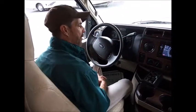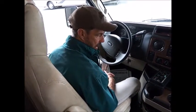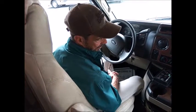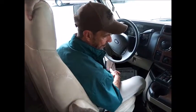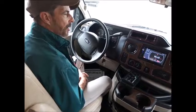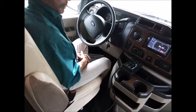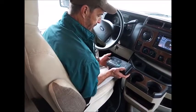When I turn the key on, it won't start going nuts on me like that. Don't drive off, man. We had one in. I don't know if it was a sensor or something. It kept telling us one of the jacks was not all the way up, and we went out there and everything was fine. Then we started driving for a while, and eventually it went off. Sometimes when that's doing that, it could just be check your hydraulic fluid. If it has a little bit of low hydraulic, it'll do that too.